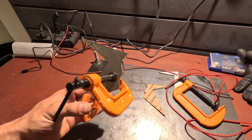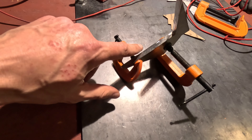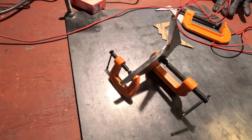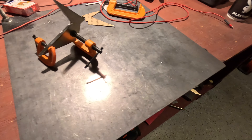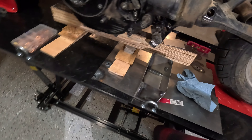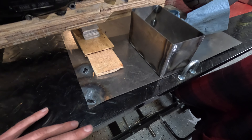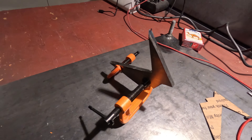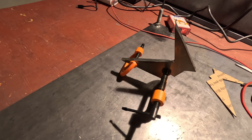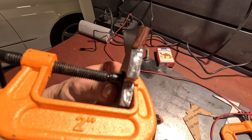Finished cutting them out at 8 PM. I still need to stack four of them together and cut them so they're very even, then stack them two each on the side. It'll be a bit heavy now but later I'll do some lightening operations — cut some holes and leave basically only what I need. I still wanted those hooks quite solid, so two on each side. Try to even them out a bit more tomorrow, then weld them on and see how it works.